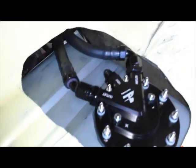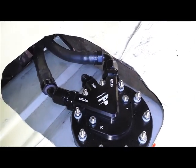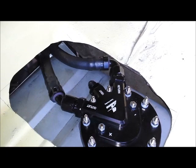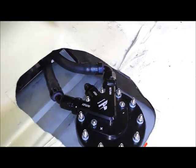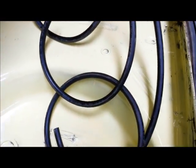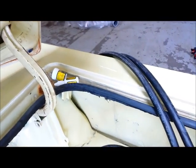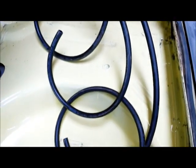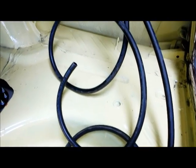Russell offers all different sizes and shapes of AN fittings with the barbed ends — it just pushes right on the end. It's super easy to put together your fuel system using the Twistlock fittings and the hose, and that's what we're using here because we actually don't want a race-type system which has to be replaced. Typically a braided line will get stiff and crack and begin to weep and leak, so this type of fuel line will last for several years without having to be replaced.